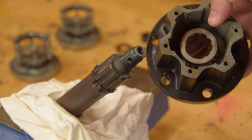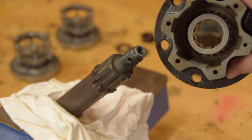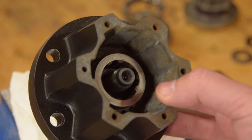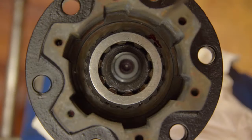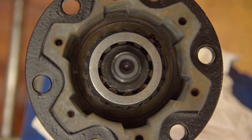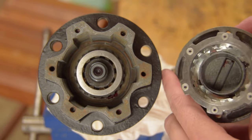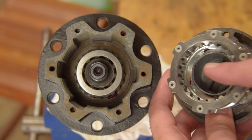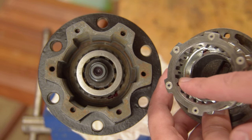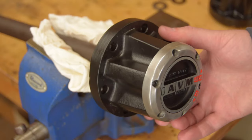You can see the gear at the center of the freewheeling hub has a spline which matches the half shaft — it plops on just like this. In the vehicle there's a seal and castle nut as well, but I'll leave those out for now. If you look down in this hole, the outside of the center gear is also splined, and the hub itself has an internal castle shape — a big spline I guess. That's where this ring selector gear thing comes in. If the ring gear is jammed down in the hole, the center gear and outside casing are locked together. So right now the hub is loosely assembled, and the selector is locked.